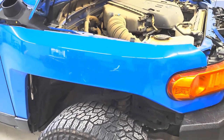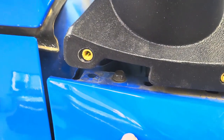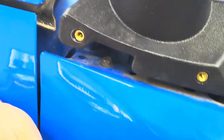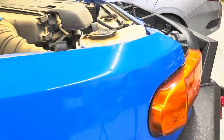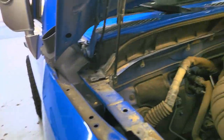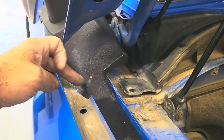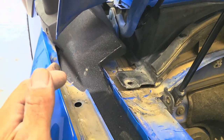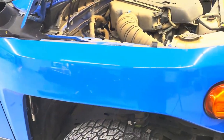I managed to bolt up the fender back up — that's snug so far. You just have to make sure you press up against the corner to get the bolt in and then tighten it up, make sure your gap lines up. Then you just bolt up your bolts. Eventually you're gonna put this cover back on, but I noticed this section here — you kind of have to trim a little bit off that trim cover because it won't fit anymore. I need to measure it to do it right, do it as clean as possible. But that's pretty much how you take off the fender and install the snorkel piece.